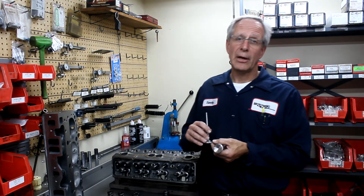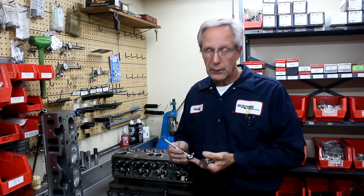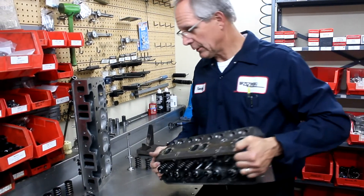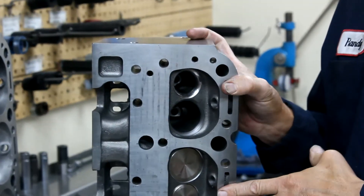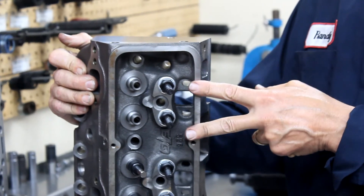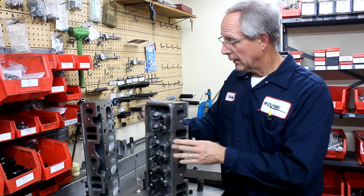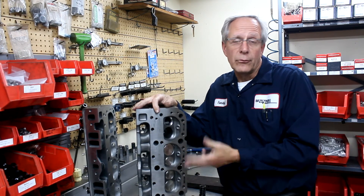From an airflow standpoint, there is some information on our website under cylinder head resources and technical data — there's a series of flow tests that we conducted on neck down stem valves versus non-neck down stems. The other machining that isn't done on these particular heads is there is no valve job done to the seats — no machining at all done to the valve seats. Of course, you wouldn't really expect it for that price. The pushrod holes are not open, so you can't run guide plates on here — you'd have to open those up. These come with some type of off-brand screw and a washer, which is fine if you don't need guide plates. And there's no surfacing done to these heads, so the chamber volume could be anywhere from 76 to 79 cc — we really don't know.